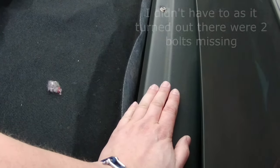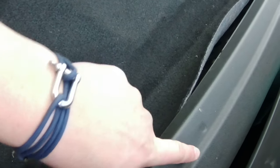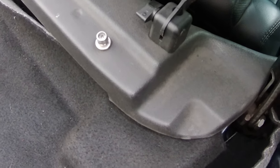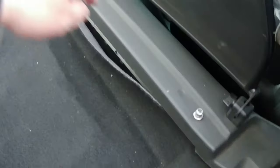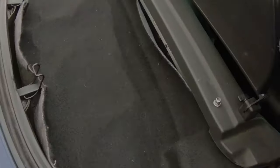is take the T-bar off, because there's very, very little clearance between the T-bar and the engine cover. So I'll get this off. I think it's just those three screws from what I can remember, but I'm going to have to take the wind deflector off as well, because those bolt down to the top of the bulkhead. Wind deflector off. Bolts are down there, one each side, and then those three, and then just lift that out so I can get the engine cover off.